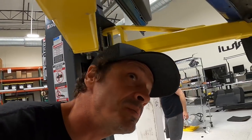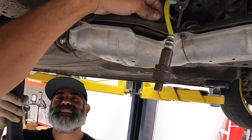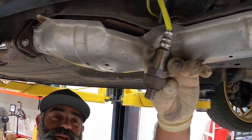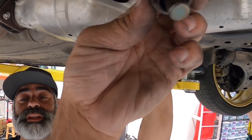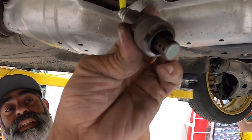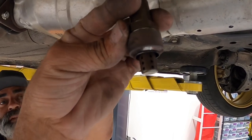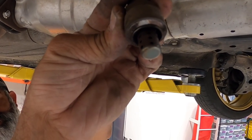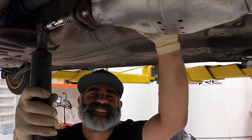So we're bolting up the exhaust and Frank here was taking off the heat shield. This is actually something you guys want to check out - the O2 sensor bung. It's common for the bung to get messed up and you'll never see it because of the heat shield. This was already on its last leg - you can see this little shiny spot right there, that's the part that was actually holding it on. He found the problem.